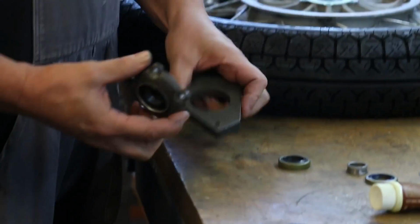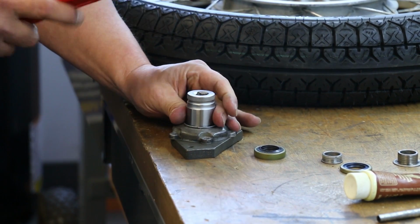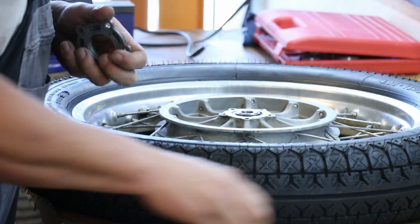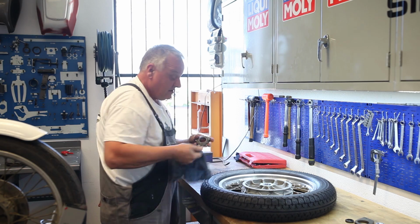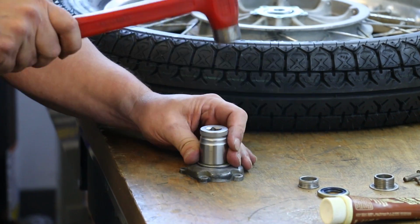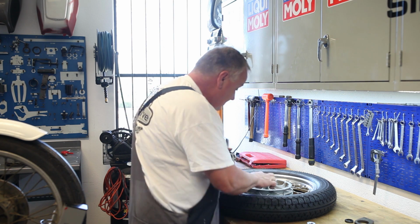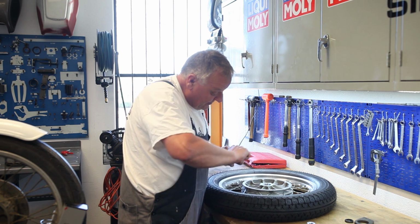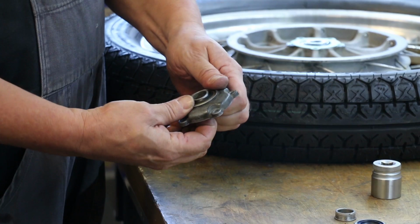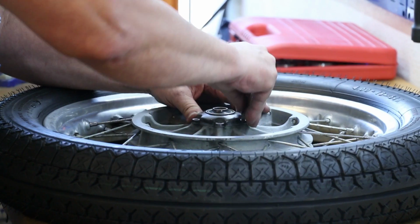I got this gearbox shimming tool. It's not gonna take a lot of impact. Just something so it has something to fall through. Like that. And then put the new seal in. Go a little bit flush like that. And then just a smear of grease on that seal. And reinsert the spacer piece right like that. And we'll bolt it back together.